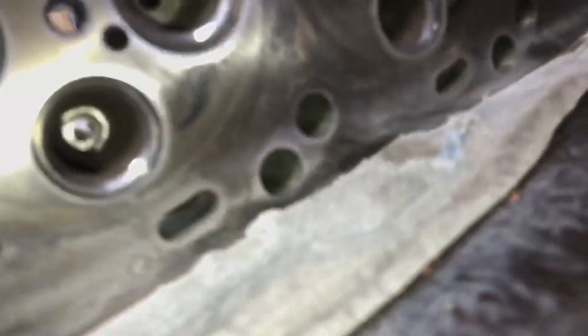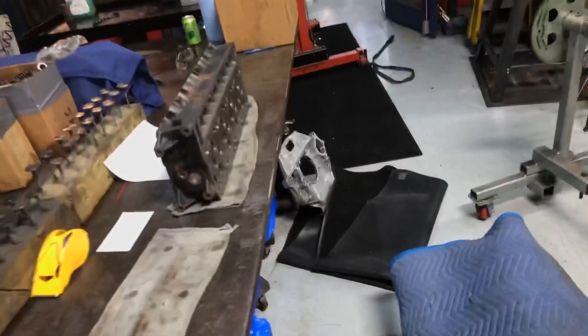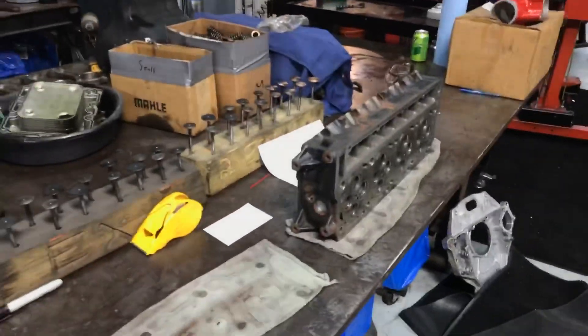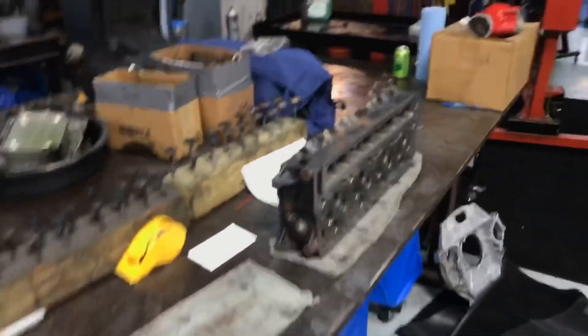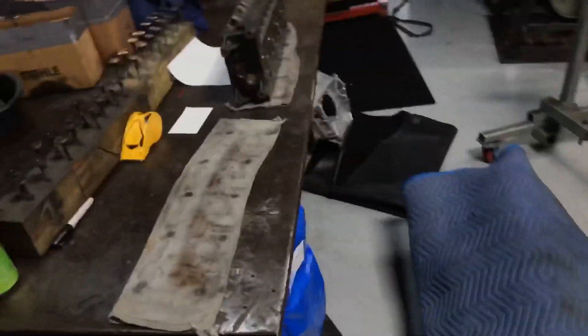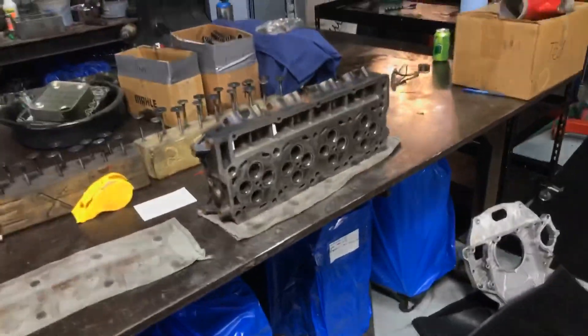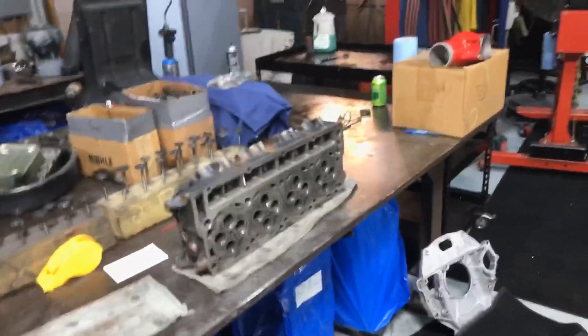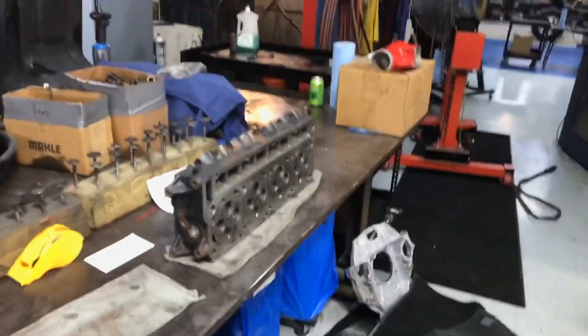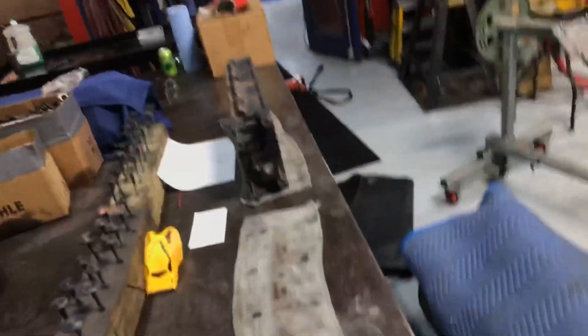The heads have already been surfaced once and they blew horribly bad. We might go ahead, clean them up, set the recession where we want, surface the heads, and then get shorter push rods. Might as well get some stronger push rods — call Manton and get some short ones. Honestly you just get the best ones they've got. You'll drop maybe 250 bucks for a set versus 100 from Ford for the 6.4 ones. I've had a couple of trucks break push rods — John Wagner's little tent truck broke one in three places.